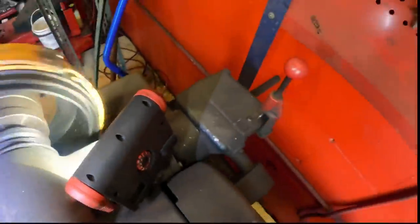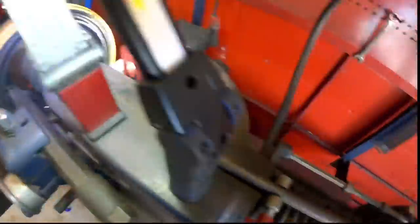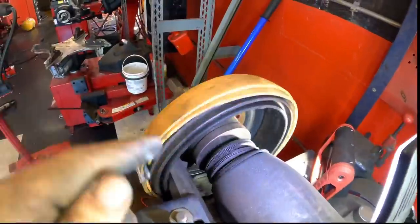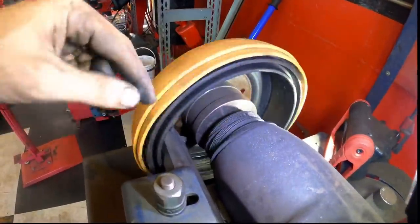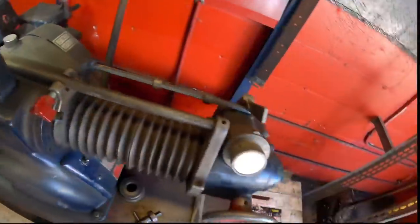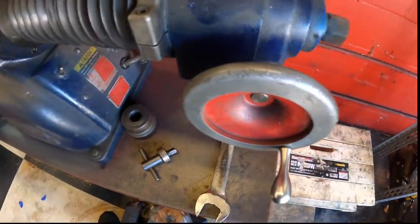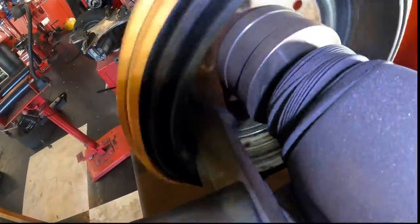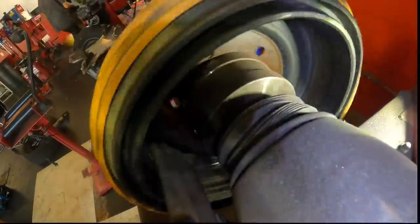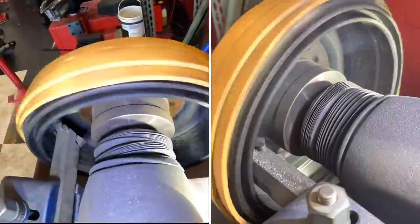Now the gear that we're going to use is not this one. This is the one that runs the spindle in and out this direction. We need to use this gear set over here, which will run this gear set, and that's going to pull the drum away from the cutting bit, dragging the drum over the bit and making a cut as it goes. Fired up. Turning. And we are cutting. All right, let's go ahead and speed things up for the sake of time. I'll see you when this cut is over with.